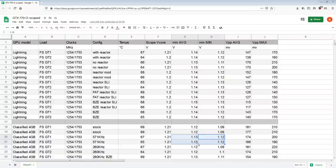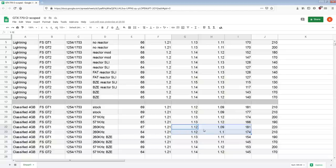The biggest problem with the Classified is that on stock settings it doesn't run a very high switching frequency. At 260 kHz we're back down to 1.09 volts — the switching frequency is very much the main thing affecting this. And the funny thing is, with the Classified Controller, as soon as you start messing with it, it seems to change the behavior of the VRM a little bit. At 260 kHz we're seeing slightly better results for GT2 on worst case minimums, but peak-to-peak has got worse in the worst case. So basically 260 kHz is essentially the same as stock.